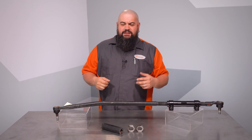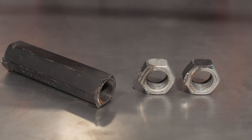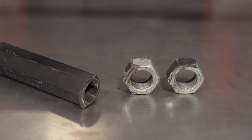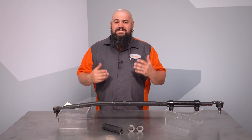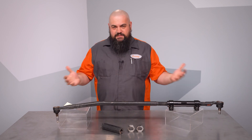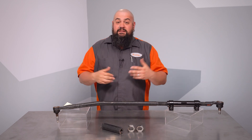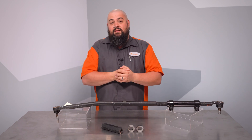Now Chrysler's fix for this in their recall was to weld the jam nuts in place — you can see we've got something going on there here. This might be an acceptable solution if they were tacked, but Chrysler specified a 17 millimeter long weld on each nut, meaning a simple drag link adjustment was more or less impossible, requiring lots of grinding and presumably re-welding. This would also be true during a normal wheel alignment.